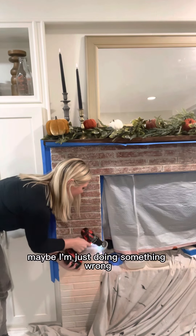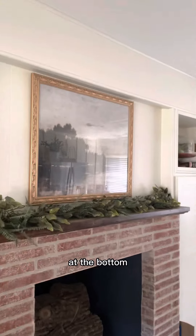The drill brush splattered all over the place, and you don't want that to splatter on your painted areas because it will remove the paint. Overall, it was kind of a waste of time and I'd have to use the manual brush anyway. They're only $8 at Walmart — maybe that was part of my problem. So now I'm going to show you my favorite method: the wire metal brush, just dipping it in water. You can see the paint collecting at the bottom — water helps it ball up, and it's a lot easier and cleaner than using rags. That ended up working great — still hard, but this was my favorite method.